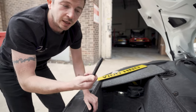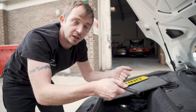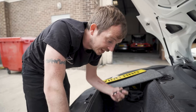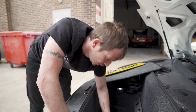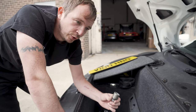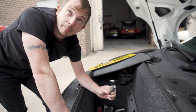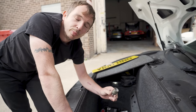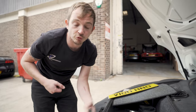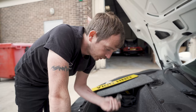That little tool is to help you get the wheel on and off. When you take the first wheel bolt out, screw that in, and it helps you get the wheel off without dinking your discs. Very important on ceramics, very easy to chip. Locking key. So you know we've worked on the car because the locking wheel bolt will be adjacent to or opposite the valve. I go mad at the boys about that. They're like proper freaks about it, so that when you're not looking, you know where you've got to put the locker when you're tightening them up. It's just one of the things that tells me we've worked on a car.